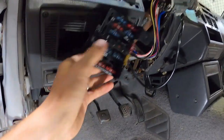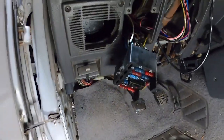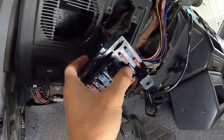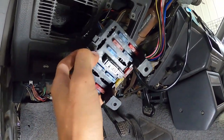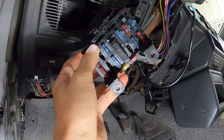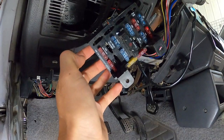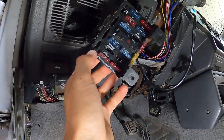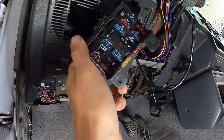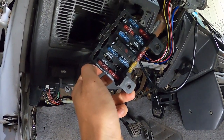So this is the chassis fuse block. I've run a power wire to the MaxECU that originally powered the stock ECU, and that hangs out on the engine fuse. My fuel pump is running off an unused fuse. The fan will go off one of these others that gets power on ignition switch. There's no AC in this truck, no radio, no rear defroster, so we've got lots of space to add a few more power leads in here.